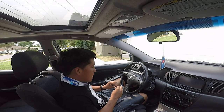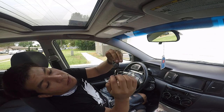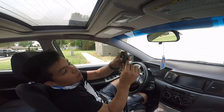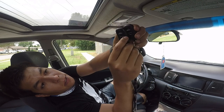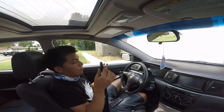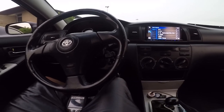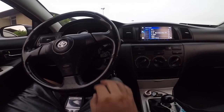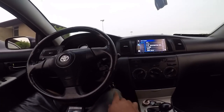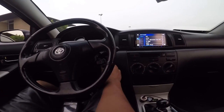It is a little broken - it's cracked right here in the middle and looks like it's gonna crack on both sides, so I couldn't put the ring on. What I did is - since it's two pieces - I took one piece and put it on the good one. Now I have two keys: one for me, one for my girl or just a spare key. One important thing: once you program the new fob, your old one won't work. So at the last step, you hold both fobs and press the lock button. Then repeat that step with both fobs and the lock button - that's how you do it.